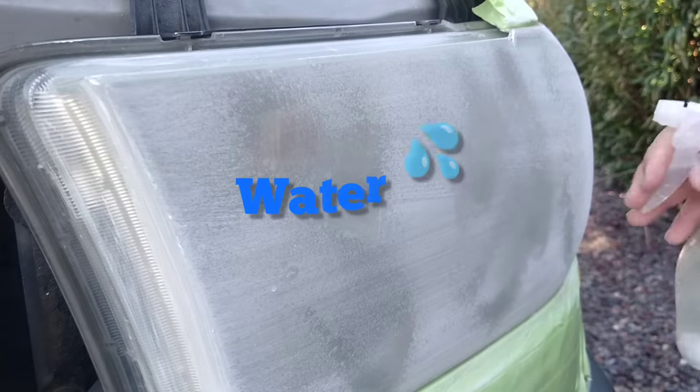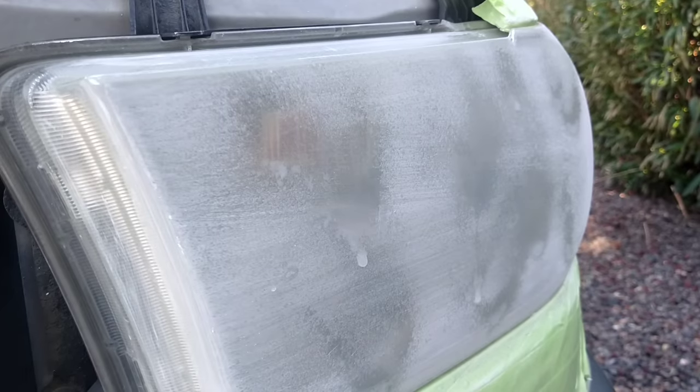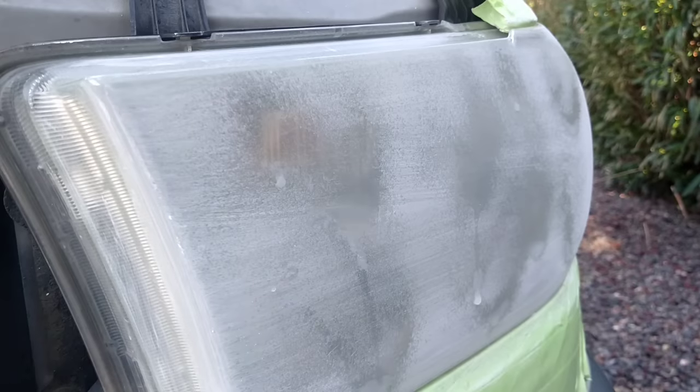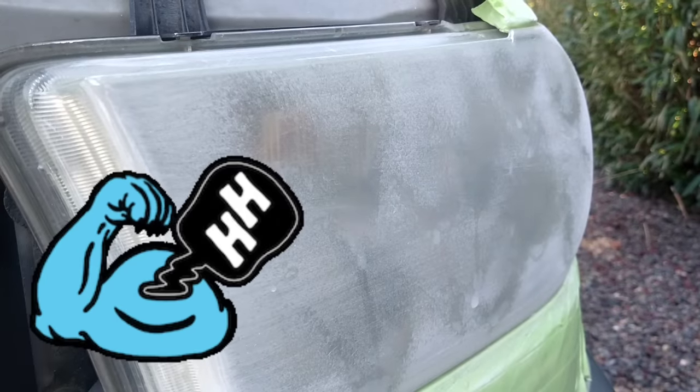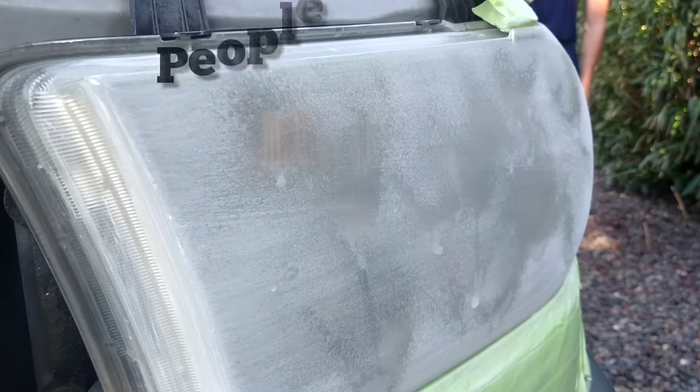I get a couple of guys in my DMs asking about swirling and how to delete it. I answer their question, but I always refer them to watch any of my videos and pay attention to that specific detail that I always say: moderate pressure. You've got to really use moderate pressure, especially with the drill, but even with your hand. You don't want to carve areas out. You use a shearing, real finesse motion. It's artistic, not mechanical. It's not a strength thing. At times, holding the drill still enough to not cause damage is a strength thing, but once you get into the groove, it's all finesse. I have 20-inch arms, but I'm not muscling this thing.